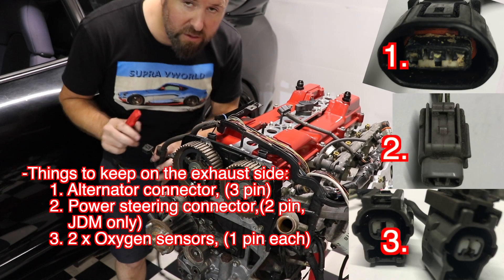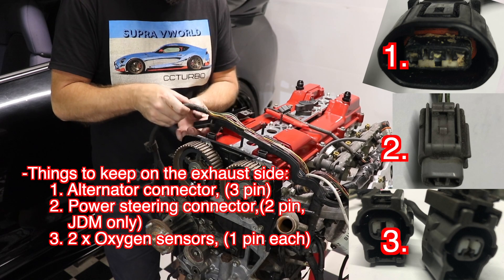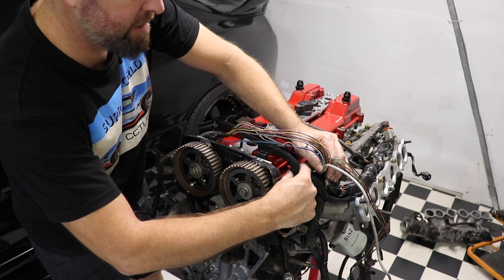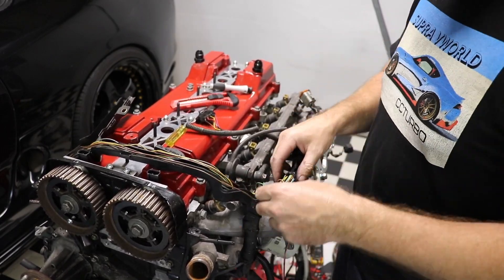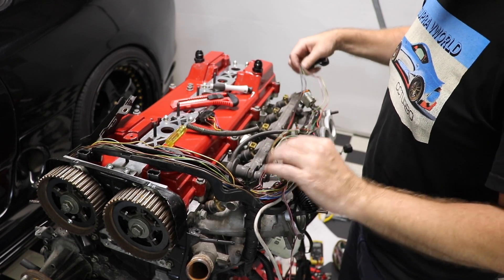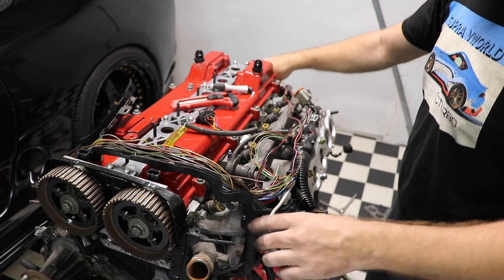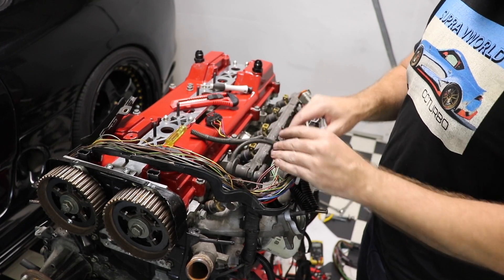For the rest we want to keep the wiring but remove this big bulky plastic housing. We can easily take that out and put some expandable braided sleeve over the top instead. I'll probably cut this piece of plastic about here — that's far enough. That one is for the idle control stepper motor, this is for the intake air temp sensor which needs the new connector — done. And that one there is the old distributor wiring which I'll tidy up.